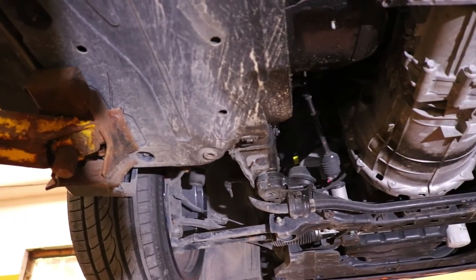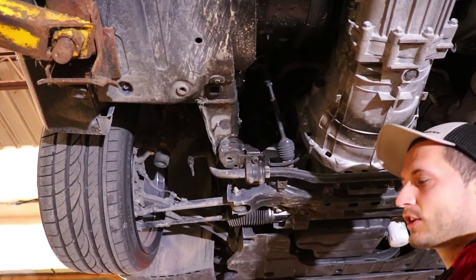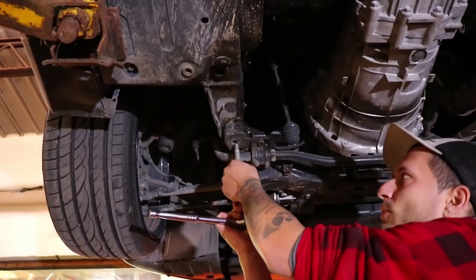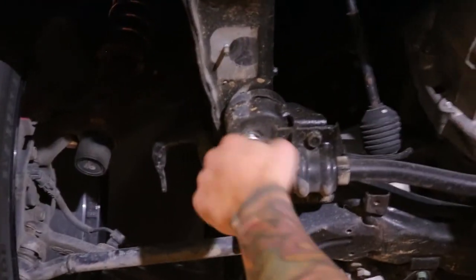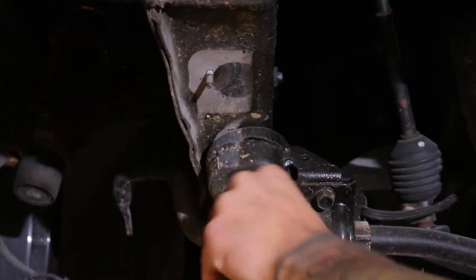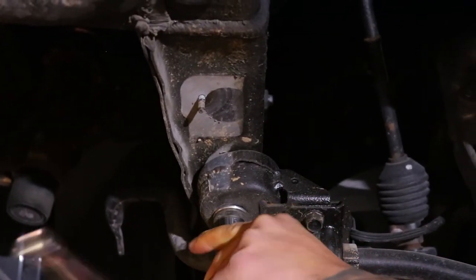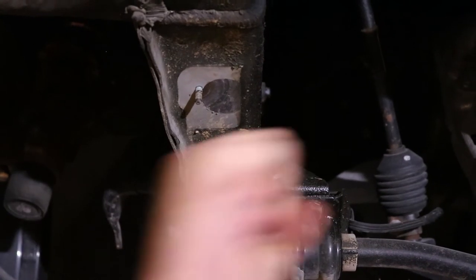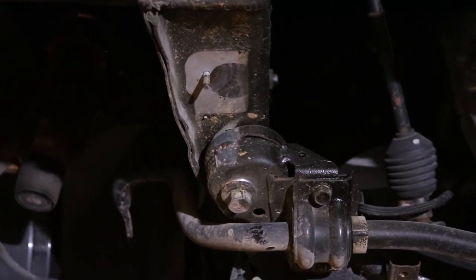There's a lot of powder up there. What I'm going to do is not put the collar in first — instead, I'm going to take the collar, slide it onto the bolt, stick it into the hole, and thread it just to get it started. Then once it's in there, I'll finish with a ratchet. Always install the collars with a ratchet — never use an impact gun, because you risk stripping the holes, and once that happens it's not fun to fix.